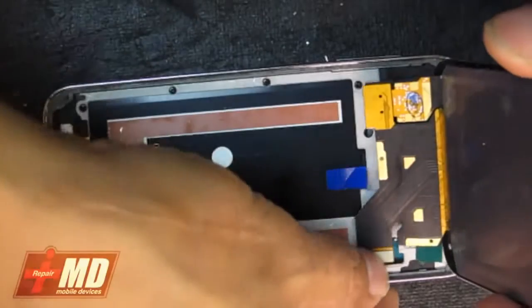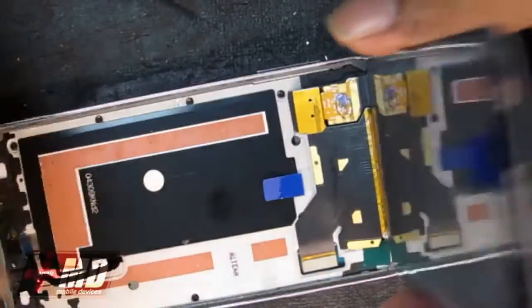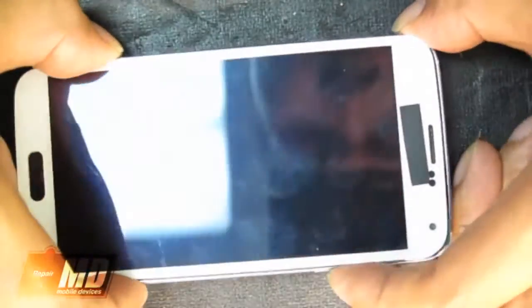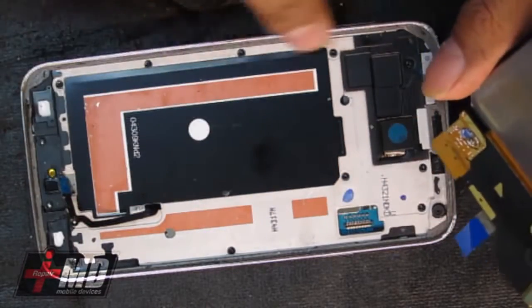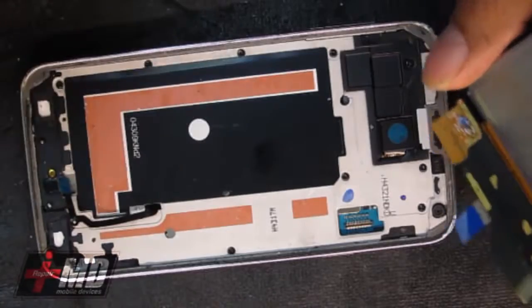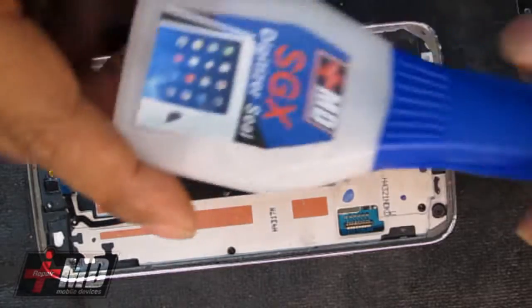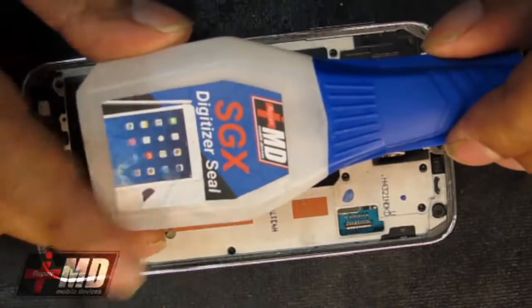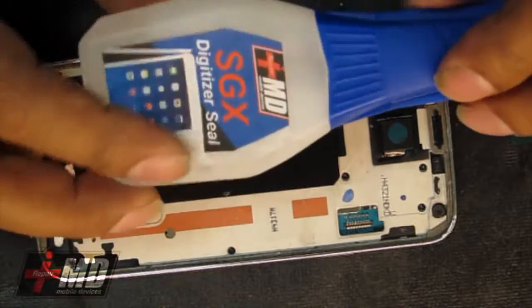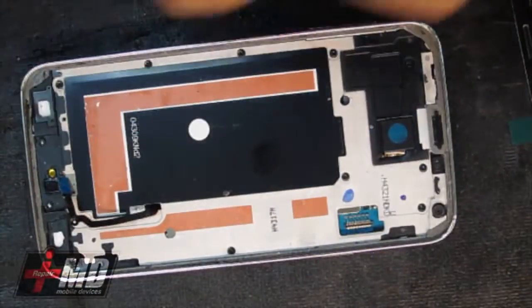The Galaxy S5, when they built this, they built it to be watertight. What you will need, because once you break it and put the new glass in, you introduce opportunity for water to actually seep in, is to get it back to the original state. And my glue, which you can get from my eBay store in the link below, is called SGX. It's a digitizer glue. It is made from silicone and it is watertight. It's actually probably better than the original glue, and I'm going to go ahead and apply this glue on.